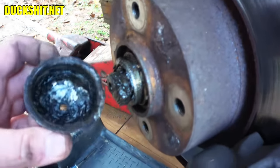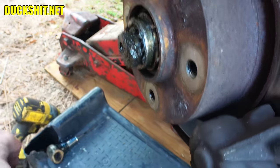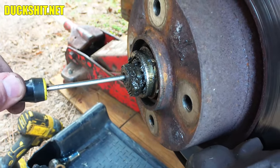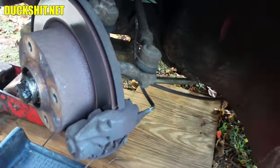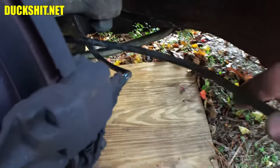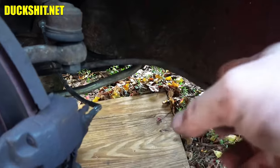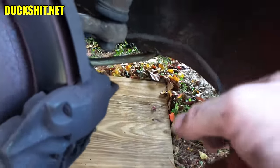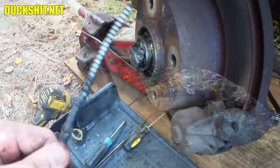I'm going to pull the cover off just for grins. Looking inside, everything's nice and greasy — doesn't look like it got wet at any point, that's good. But the cable is long buried up inside the spindle. I can still feel it in there. This has been one of the trickiest things I've dealt with. Before, I've actually grabbed it with one hand and used my foot and was able to push it out. But in this case I feel this cable stretching — it's just like a giant skinny slinky. I might still try it again anyway. With the foot method, sure enough it pulled right on out.